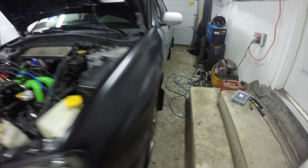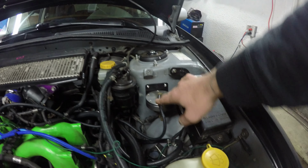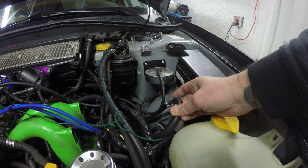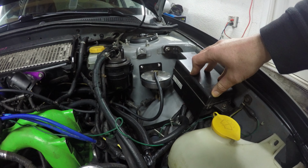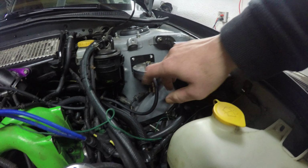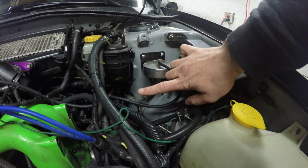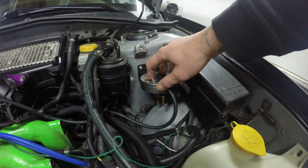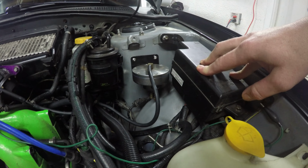And now that the wheels are all done, the fuel metering unit, I've left this unhooked for the last while, basically just bypassed it and put the return line back to the tank and just haven't been stepping into boost. But with winter coming on, I'm gonna wanna play a little bit, I guess. So the fittings that are in this thing are quarter, and I've got some 5/16 fittings to put into it to try and improve the porting going to the FMU to try and get my fuel pressure a little better.